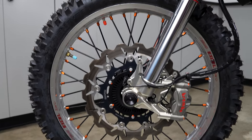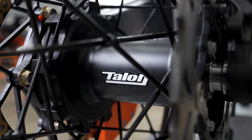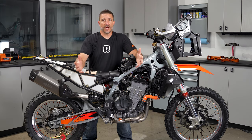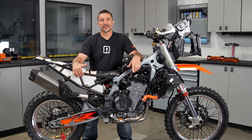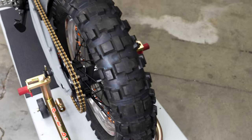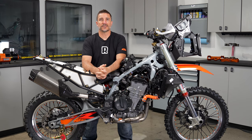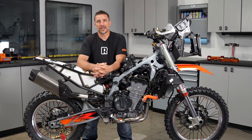In the front we run a 1.85-inch rim. We've seen people go down to 1.6, which has a similar effect to the rear. These are either Han or Talon hubs with thicker spokes and Excel wheels; you can also opt for higher-quality DID wheels. As far as tires go, that's going to be a personal preference. We run Dunlop 908 tires in the rear — great traction off-road, especially with the 2.5-inch wide rims, and a really nice round profile much like a dirt bike. If you run that on the highway, it'll wear out pretty quickly. For wheels and tires overall: for highway stuff go wider, for off-road go narrower. Some people get multiple sets.